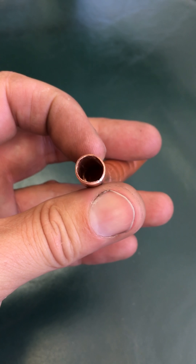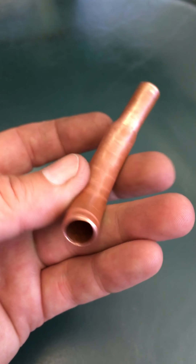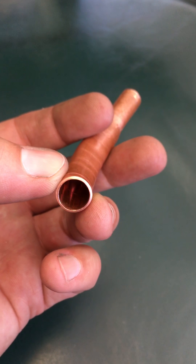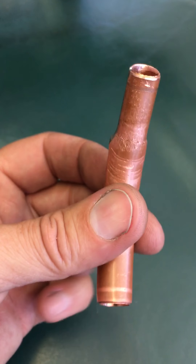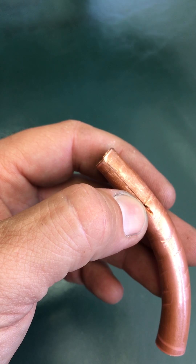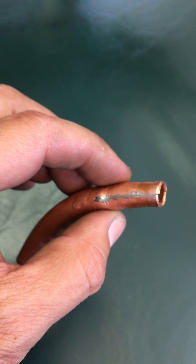The three-eighths end goes into the carburetor. What we've done is take a half-inch piece of copper tubing — the outer diameter is almost nine-sixteenths, so it fits right into the hose that goes to the brake booster. We've sliced it on both sides using a die grinder with a thin blade, though you could also use a hacksaw.